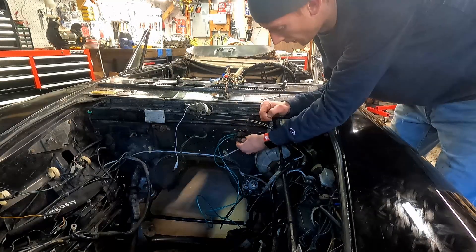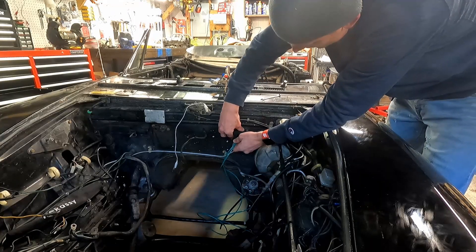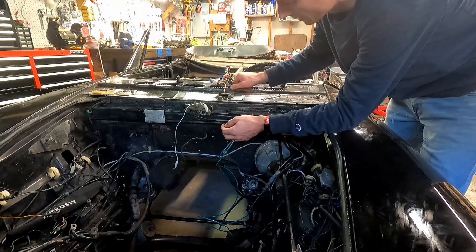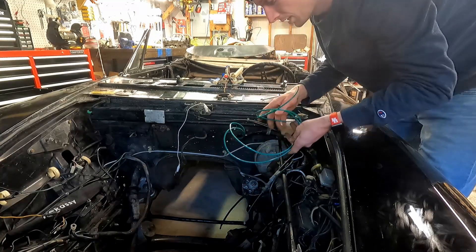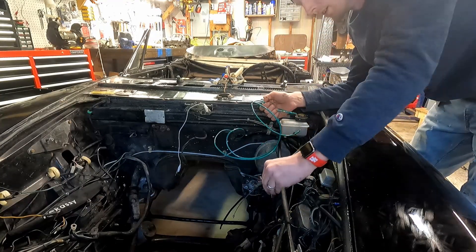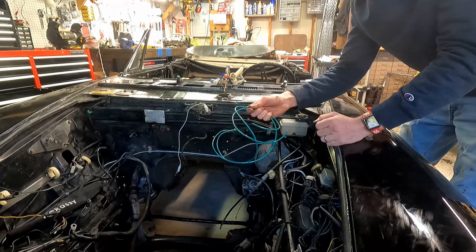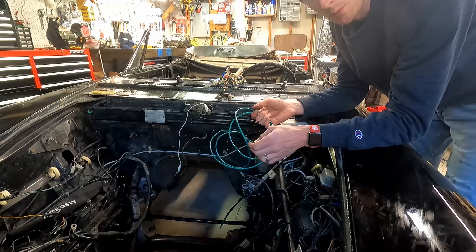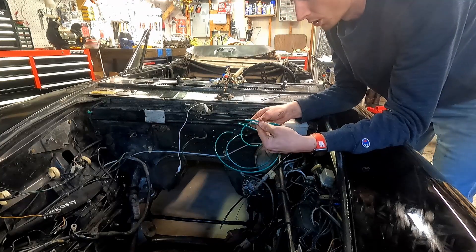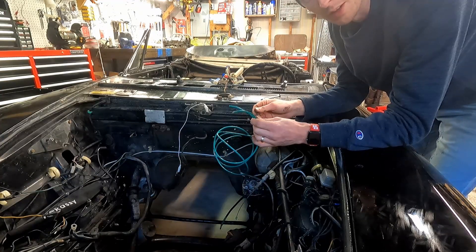The green wire is coming through the firewall, and our little rubber grommet does have a slot in it for the wires to come through. We'll clean up and repaint the metal retainer. The old brown wire, which we're not using anymore, is being removed and disconnected. The new wires coming through will have ring terminals soldered on so we can attach them to the starter. Double is better - and that is our brown wire fix. All we have to do is attach this to the starter. Less resistance, brighter lights, and less heat - always a good thing when it comes to electrical.